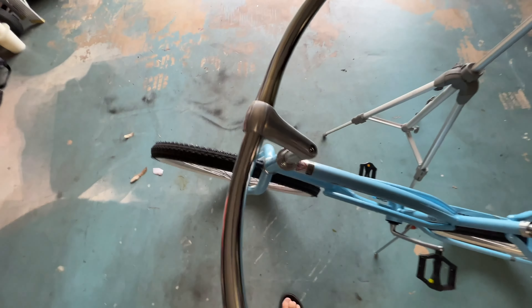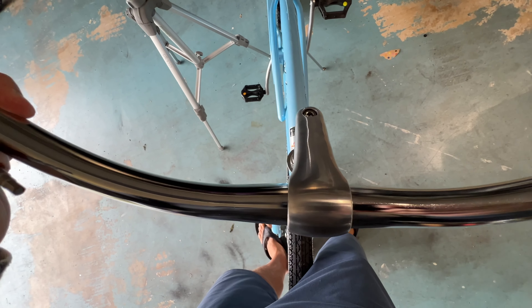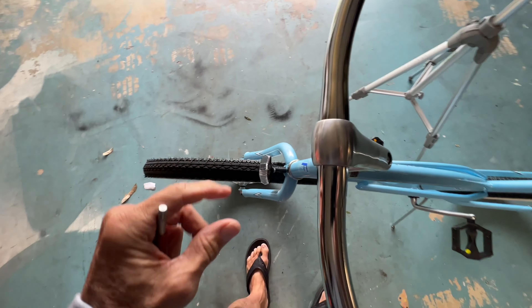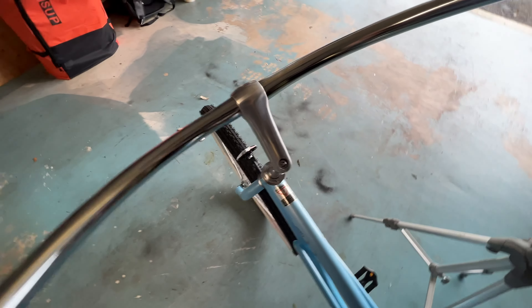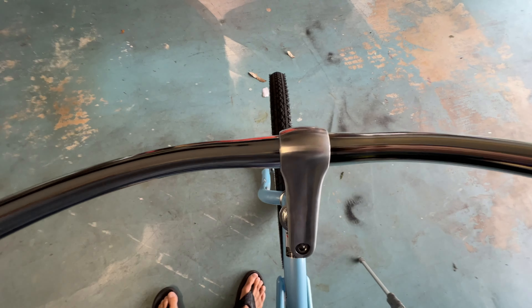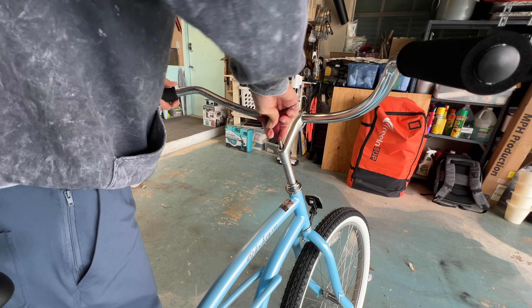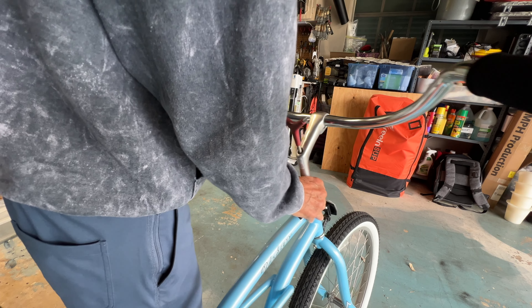I've tightened it a little bit but not a lot, because I want to make sure it's straight. See where my wheel is — I've got to get my wheel straight. You want to make sure the wheel is parallel with the center bar, and then your handlebar should be 90 degrees off of that. When you look down you should see your wheel straight — you don't want your wheel or your handlebars off kilter.